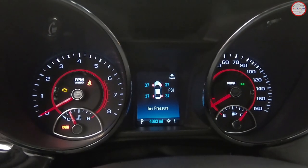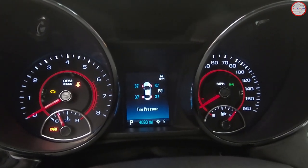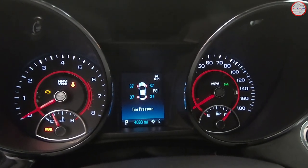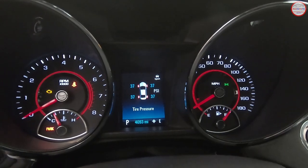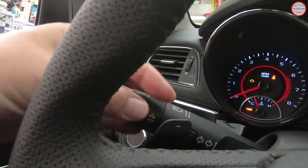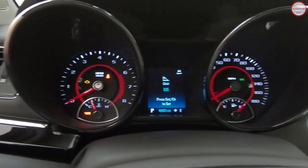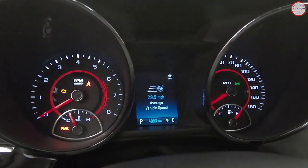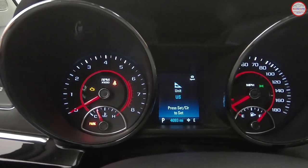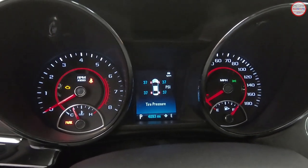Now that we have service only mode active, we need to place it into the tire pressure screen. In my particular case, I normally run with the tire pressure screen as my main driver information center screen, but if you're not, you need to use the scroll wheel on your turn signal stalk to adjust which screen is active and possibly use the menu selection. Pressing the menu will toggle between trip and fuel and the vehicle information menu — you need to be on the vehicle information menu and from there scroll to the tire pressure screen.